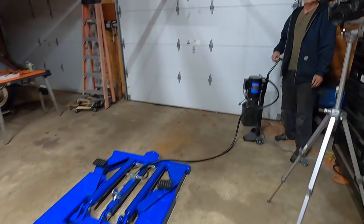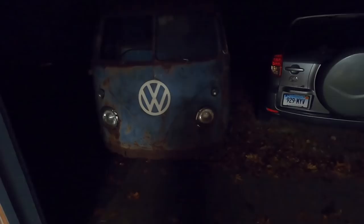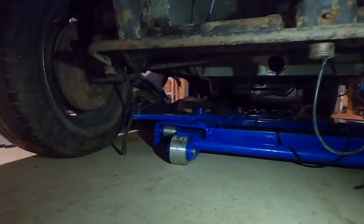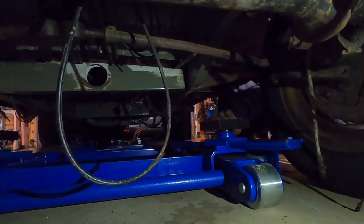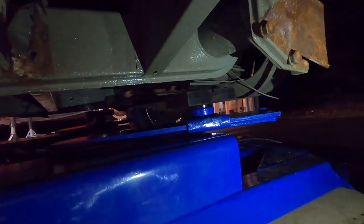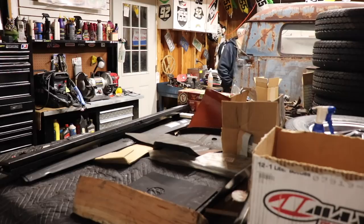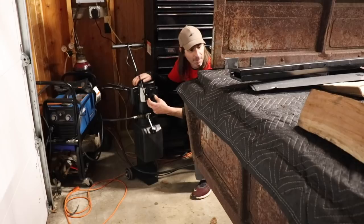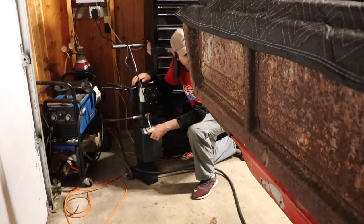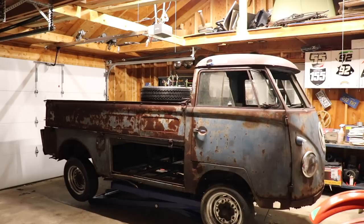I'd say we need a car. We have one — it's a rough old single cab. Let's bring it in. Look good all the way around? Seems like it's not going to fall off. Before you raise it, make sure she's nice and snug. So we've got one button to go up. Now we're going to lower it down onto the safety lock. There it is — we're good to get to work.